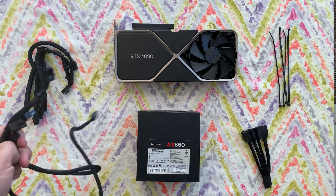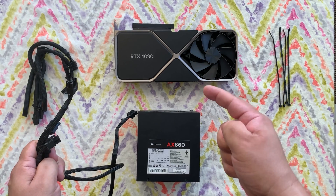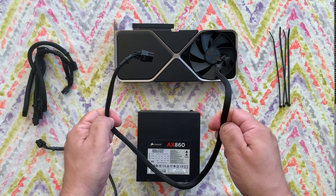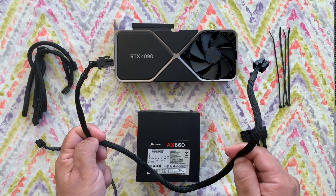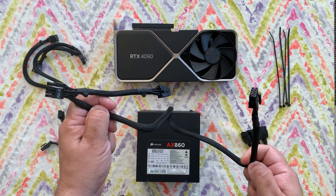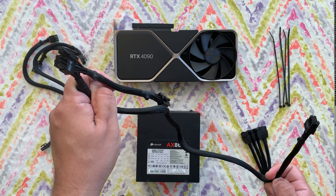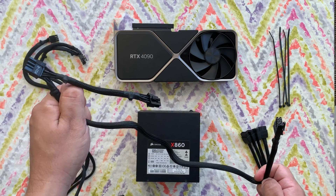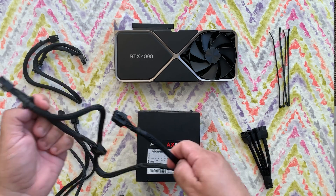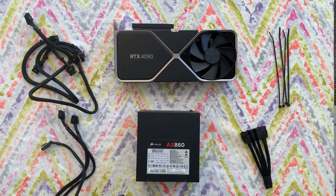This mess over here are the power cables that came with my power supply. Your power supply should include the cables you need to run your RTX 4090. Included with my power supply, I had two sets of cables. The first set has two cables — one side connects to the power supply, the other end is a single 8-pin power connector for the GPU. The second type connects to the power supply but has an 8-pin connector daisy-chained to another 8-pin connector. It is not recommended to use two connectors from a daisy-chain cable. They want you to use four individual cables, so I'll use the two straight single-connector cables plus the two from the daisy-chain set.